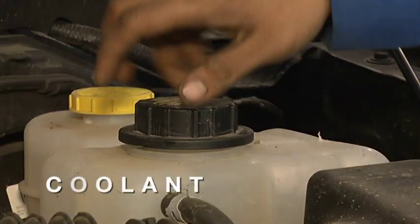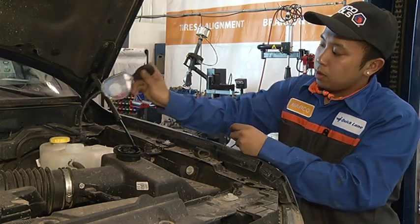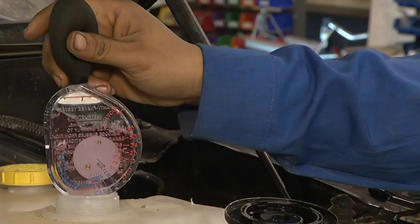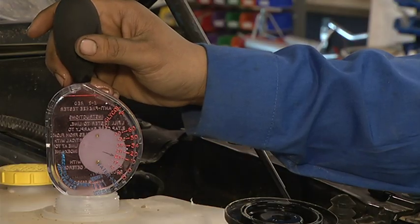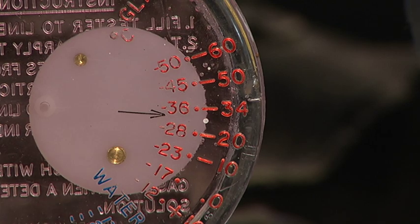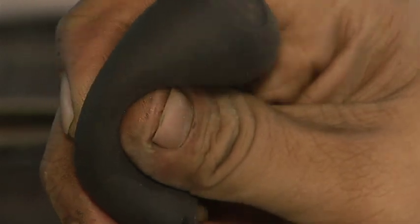The coolant is there to maintain a certain engine temperature, along with supplying the hot coolant to the heater core for the heater inside the vehicle. It's definitely something that should be checked at least twice a year. We're going to check the strength of it, make sure it's not going to freeze up in the wintertime — so it's good for at least minus 35 degrees. We're going to check the acid level in it, make sure that it doesn't need to be replaced. It's a very important thing that unfortunately sometimes is overlooked, and it ends up causing a lot of grief down the road.